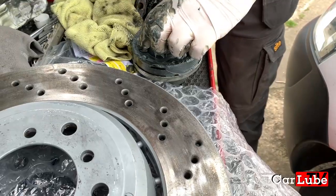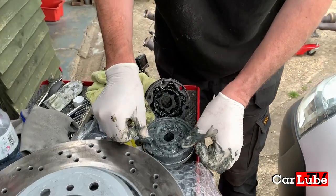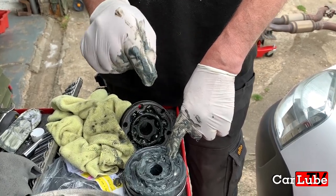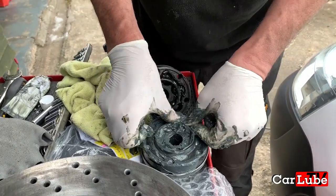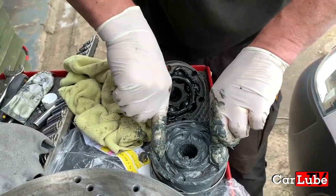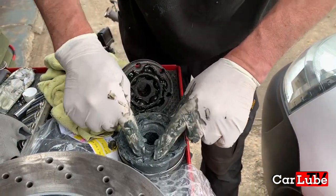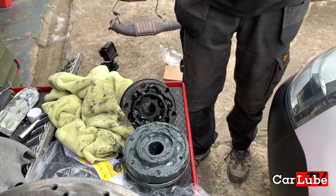I think this is dealing with over 400 brake horsepower. It's all going through this joint. And you've got 6 ball bearings, but actually only a couple of those parts of it are handling the power at any one time. So it's not surprising that they do fail. So just to let everyone know, my car's got 54,500 miles on it. So this part may fail every 50,000 miles for all we know. If this fixes it, it is obviously a weak spot on the car. I need you to be more positive than that, Malcolm. But when it fixes it, yes, indeed, it confirms that it's a weak spot on the car.